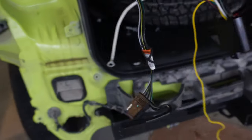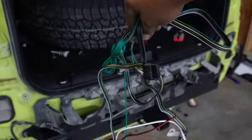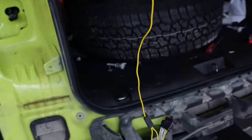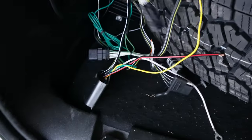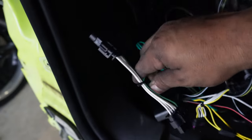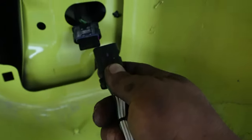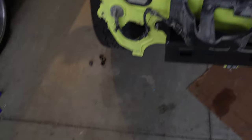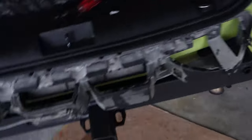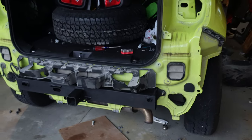I'm going to show you the wiring harness that came with the whole set. It's actually pretty straightforward. You have two connectors: a yellow one and a green one. These plug into your tail light — they exchange. This connector goes into the tail light here on the harness side, and then this one goes into the tail light on the other side. I'll pre-install it, but I want to fully install it once I cut out the bezel piece.